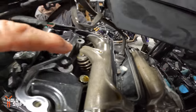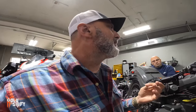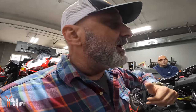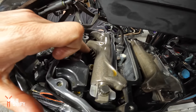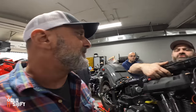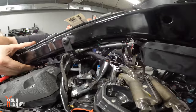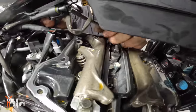And obviously, the 3030 has a high lift, 485. Everybody says that the 45 can still use the stock valve springs, but we're again bulletproofing it. We're putting S&S springs, the S&S Sidewinders. Sidewinders, again, to bulletproof the build.